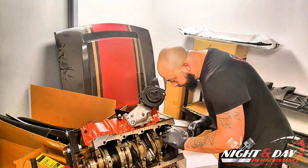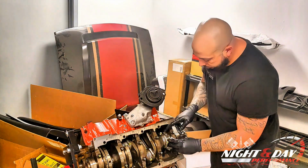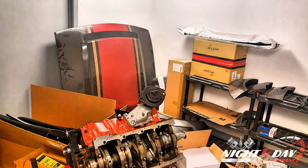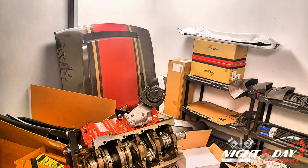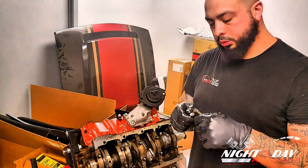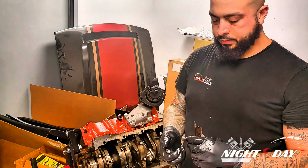So I'm going to locate now. I have numbers on top, numbers on my rod cap. I'm going to slide that on. And then on your rod, folks, most companies have some type of an assembly lube you're supposed to use. Molnar has this little assembly lube that you're supposed to put on the bolts. So rub a little bit on the bolts. Like that.